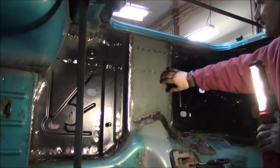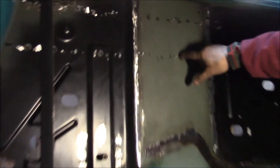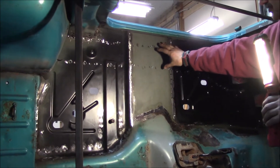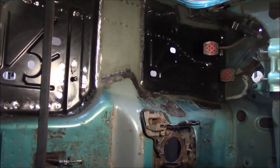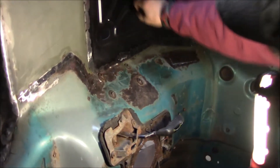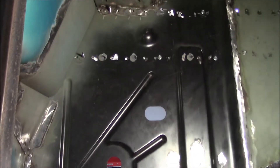The torque box is screwed into place. All my holes for the plug welds are drilled, and I ground the burrs off, then screwed the torque box back on, took a marker, and marked where all the welds were. Because I'd already put some etching primer on the inside of the torque box, I was able to take a Dremel tool and clean off the metal right where I was going to weld — the rest of it has primer on it. I had to make a lot of patches to get it ready: one here, one here, one in here. I had to rebuild the bottom of the pillar — this was rusted up to here. And here's the footwell patch I made.